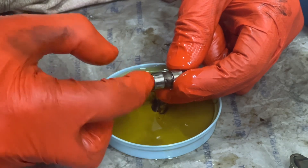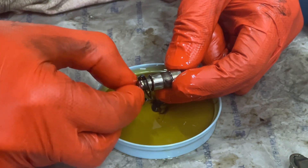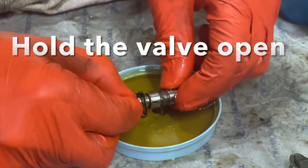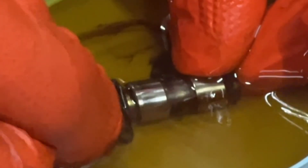Now what I need to do is hold the drill bit and push on the piston. Now as I dip that in the oil, we can see all those air bubbles come out. So now I'm pulling in fluid and pushing air out. Now we can see that the bubbles have stopped - there is one bubble there but it keeps retracting.